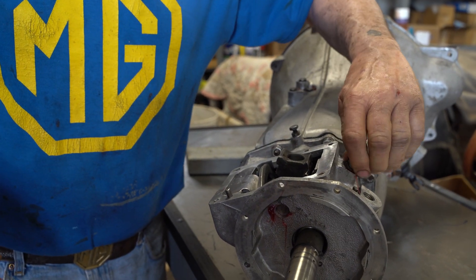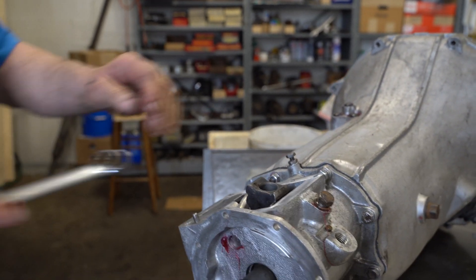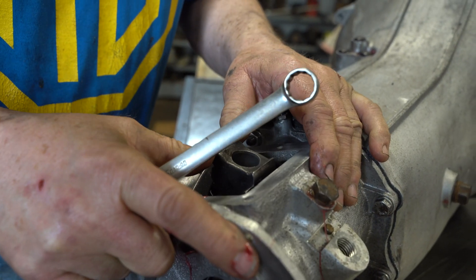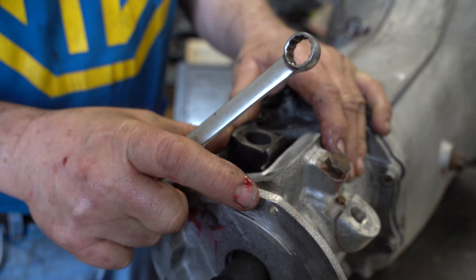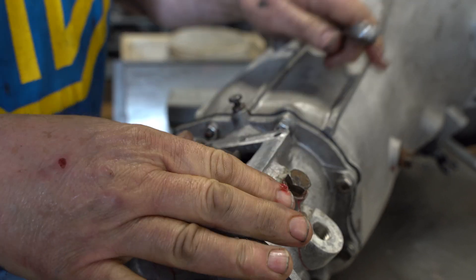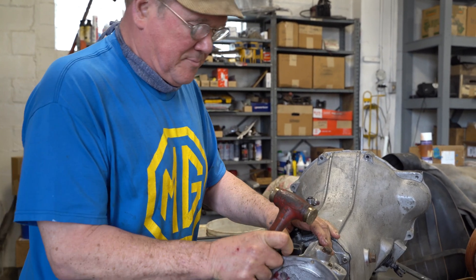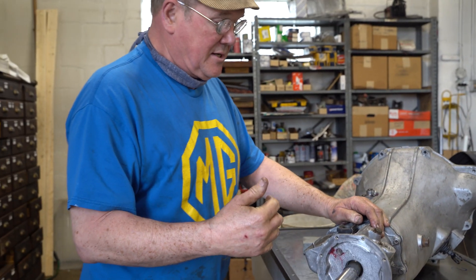Engaging reverse becomes extremely easy when it jams up. If it jams down, you can't engage reverse. This is accessible with a five-eighths underneath the vehicle. Now when we push it over with the plunger installed, it isn't so easy — we have to push much harder. You can't see the strain on my thumbs, but the point is made: it got very difficult to engage. You can use a hammer, but you cannot simply push it into place — you need a slap. And that's what you do up on the gear lever: slap it into reverse.